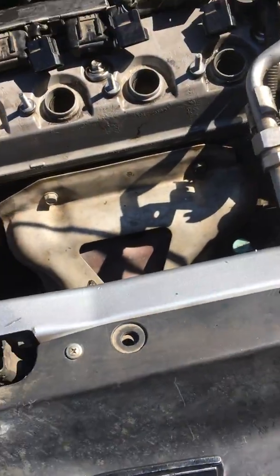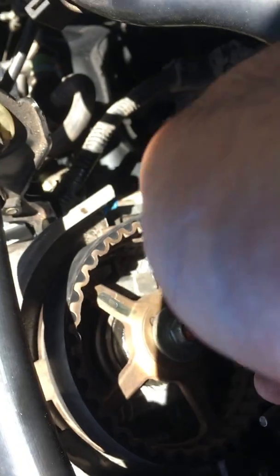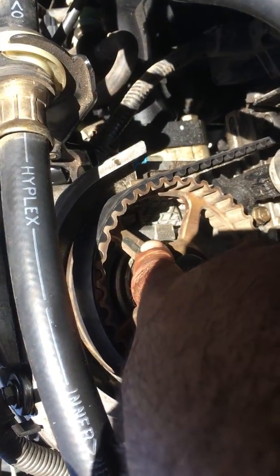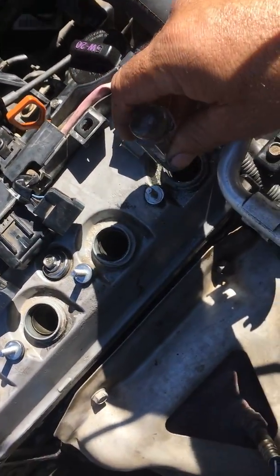The next step - I need to get to this pulley right there and put it right in there. If you look up in here, this cover was already gone, but you see up right there where my finger's pointed? It says 'UP' right there - that's gonna be top dead center. Before I get to top dead center, I'm gonna put the screwdriver in here. They say don't use something hard because you will damage the piston as it comes up, but I'm gonna be careful.